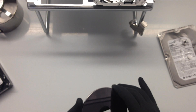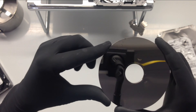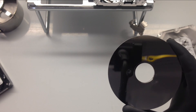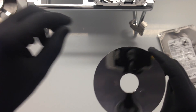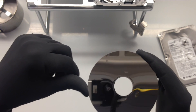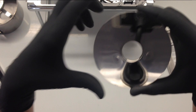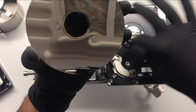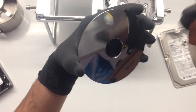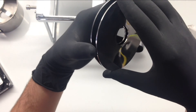The hammer did a lot of destruction. What was it about these platters that meant we couldn't get data off them? If you have a look on the flip side, we can actually see indentations where the chassis punctured them. These platters are completely warped — warped enough that they couldn't spin up, so the drive seized. You can also see various marks from other components. There are two platters here — you can see three dents that line up where they pressed against the riveting seals, same thing on the inside.